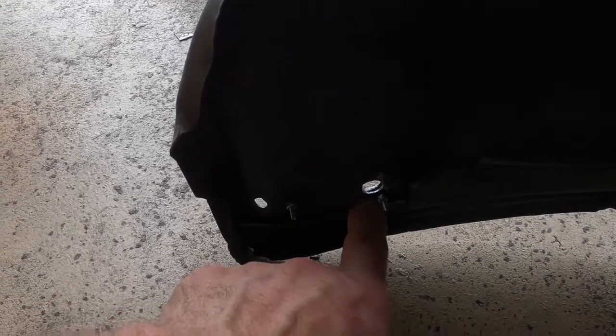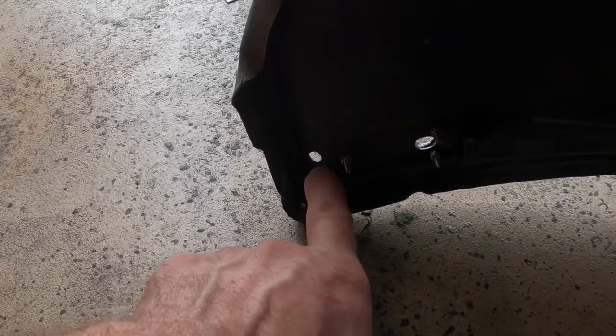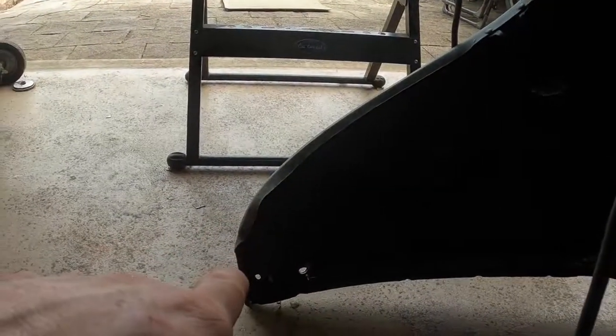We're going to have to do a lot of nice body work on the top there anyway, from where I welded and screwed that all up. All right, so then after I get those brackets off, you see there's a hole right down there. Not this one, that's our pin for our lift and to secure it when it's down. This hole right here, I actually had to drill that in there way back when, because there was a stuck bolt in there and I couldn't get to it, and that was the only way to get to it. So I got to plug weld that up and grind it over. And the antenna hole over there, I'm going to have to take care of that as well.